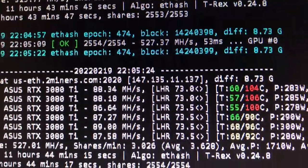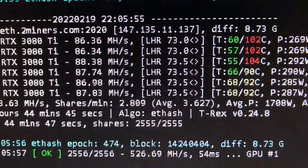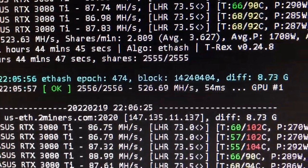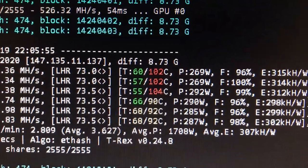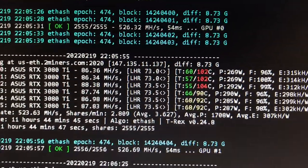I'm new to this. I've been doing this since October and I've never replaced thermal pads. I know about thermal pads, putting heatsinks on CPUs and stuff like that — I get it. But I never replaced the thermal pads. So I think these temperatures in the red are an indication that I need to go ahead and replace them.